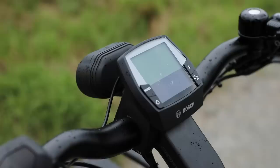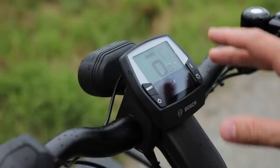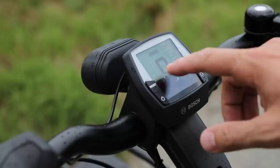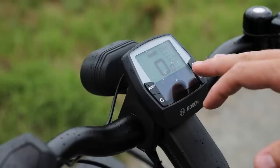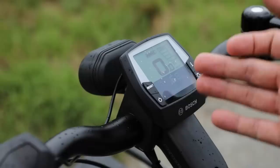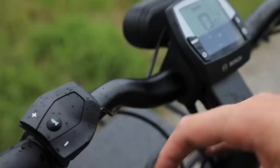It's starting to rain a little bit but I'm just going to keep going. If we want to turn the system on, we just hit the power button here. This is the Intuvia display, but the bike is also available with the Kiox display on all models, or the Smart Hub display on all but the Roloff models. When we turn the system on, you get the battery life — currently has a full charge — and that's going to show the average of the two batteries. You get the speedometer, currently set to kilometers per hour because that's what they use in Germany. You can change this to miles per hour. The range shows how much assistance you have left and how many miles you can go, based on the assistance level — right now it's on turbo mode. The default level will be off; the first level is 60% assistance, up from 50% last year. Tour mode is 140%.